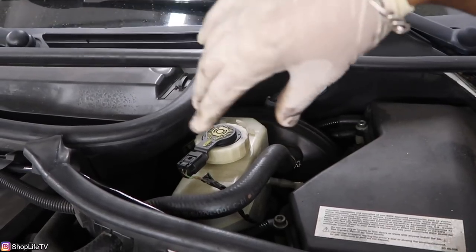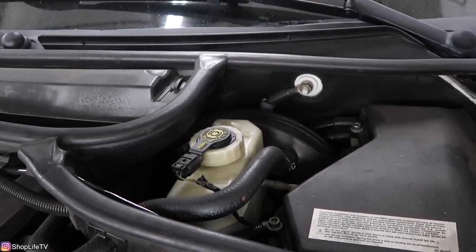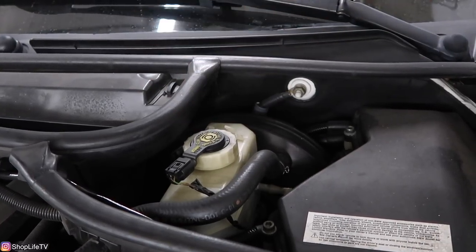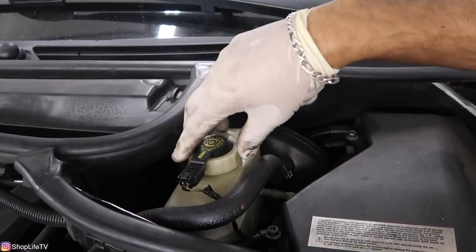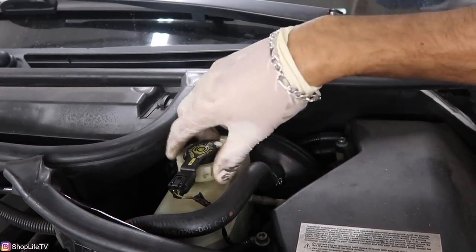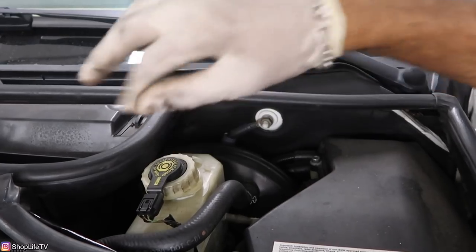You will also need a lot of brake fluid since it's a good time to flush out all of your old brake fluid and re-bleed the brakes. We'll start off by doing this since we are going to be compressing the piston for the caliper. We're going to remove the brake fluid reservoir cap so no pressure gets built up and we don't risk anything else. Loosen that up, pull it off — you don't have to take it off completely, just have it off like that.